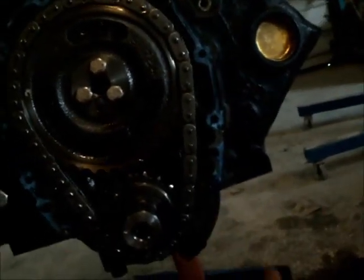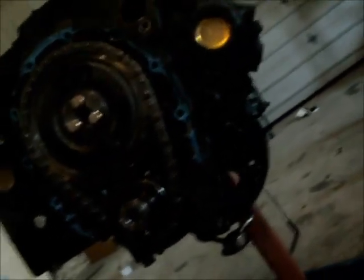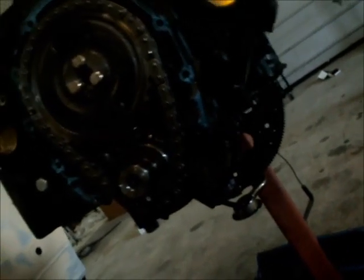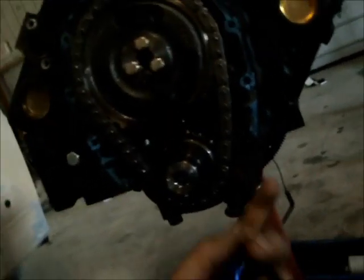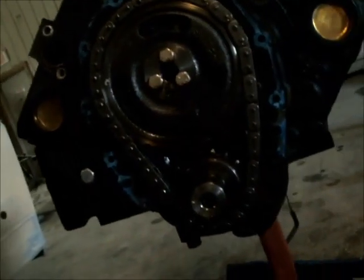Is there anything fucking wrong about this? A factory timing chain — not even a double roller. This motor has just under 1500 miles on it. I did the valve springs at around 80 to 100 miles, and he's been running it since then. But it's been burning oil. I'm trying to figure out why — I think it's probably got a broken ring. This is no good. Thank you Blueprint — don't get much for five grand from these guys, I guess.